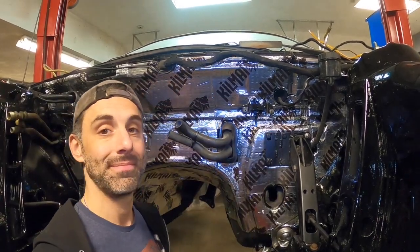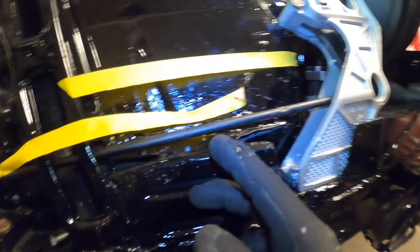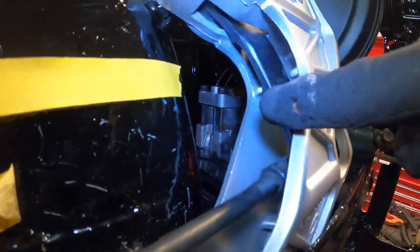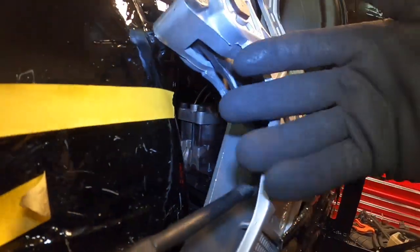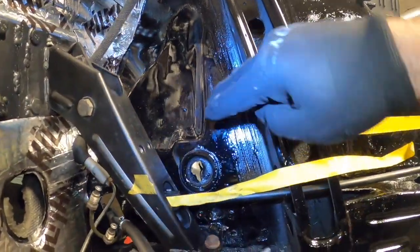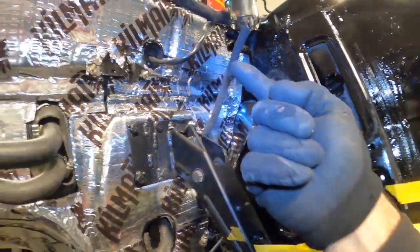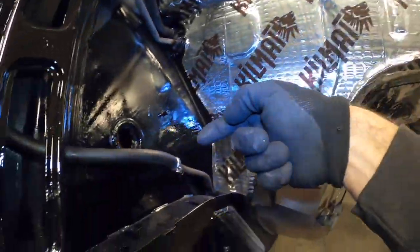or your plumbing. So as we're contemplating the brake lines, we're trying to consider everything else that the brake lines also interact with. And that includes the fuel line and the clutch line and the steering column. So we're gonna have four brake lines coming out from where that ABS pump is. Those four lines are gonna be coming out and going to each of the individual wheels. The front left is easy, goes right through here. The front right is actually quite easy because that comes up, around, down, and through there. So that's gonna be pretty easy too.